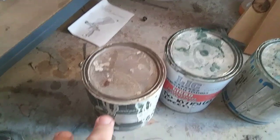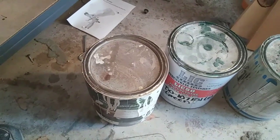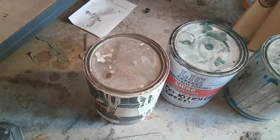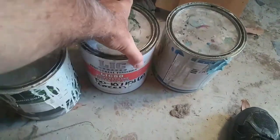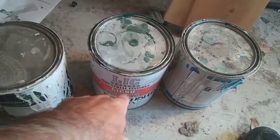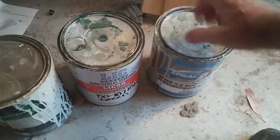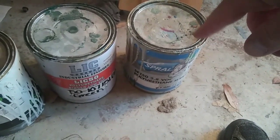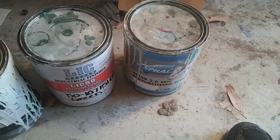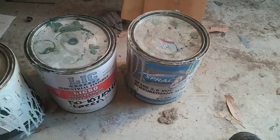I got this so level it was just beautiful — almost no need to buff it. The only reason I buffed it was because there was dust in it. This other one here is a little bit tougher to get no orange peel in. It feels thicker. This one here is their actual automotive product — this is an industrial finish, and this is the actual automotive from Valspar.